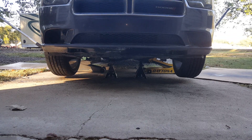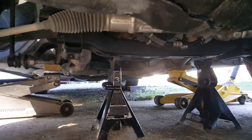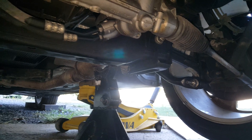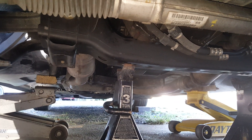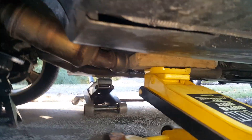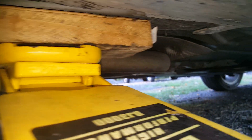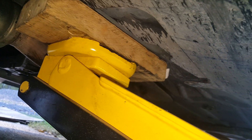We lifted the car up. I've got a jack stand under this crossmember here, and we've used a jack on each side. I've placed it right along this beam, part of the subframe. You could place it back on other parts of the body in various places — pinch welds, etc. I've just come back here behind the wheel, and we've got this part of the frame. I'm just using a block of wood here, getting right along that, and done the same thing on the other side.